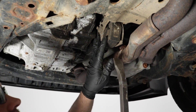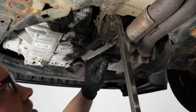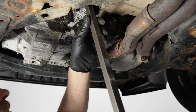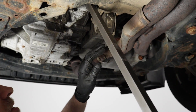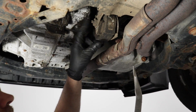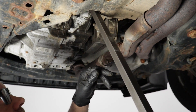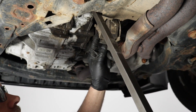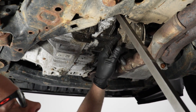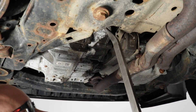If you want to check out one of these dog bone mounts with a pry bar, get in between the frame and the mount and just pry them out. If you see movement like this, or even in between the engine and transmission, that would be excessive. We actually loosened up this bolt just to show how much movement you could end up with. If it's broken, you'll see a major cracking in there and you'll know the mount has to be replaced.